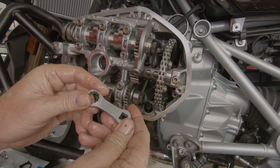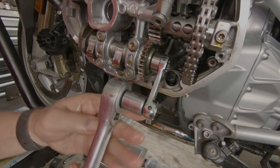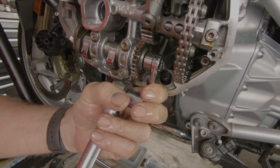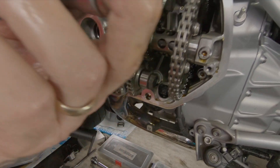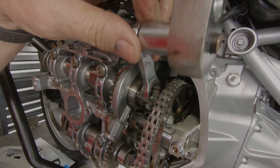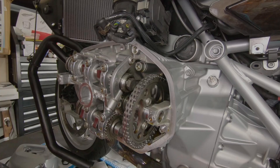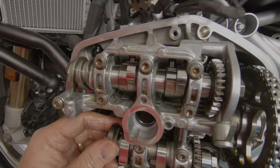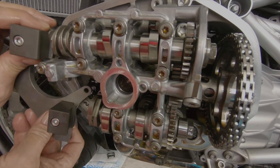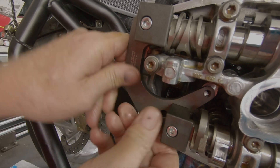This is a 5/8-inch — equivalent to 16 millimeters — offset tool for releasing the bolt that's holding the cams. We loosen this one and get the other one loose as well. Now you can see the camshaft is free from the gear that drives it. Both the intake and exhaust cams are free. Now we can use the alignment jig and rotate the cam to get it to go into the space inside the alignment jig. The bottom one is locked on.